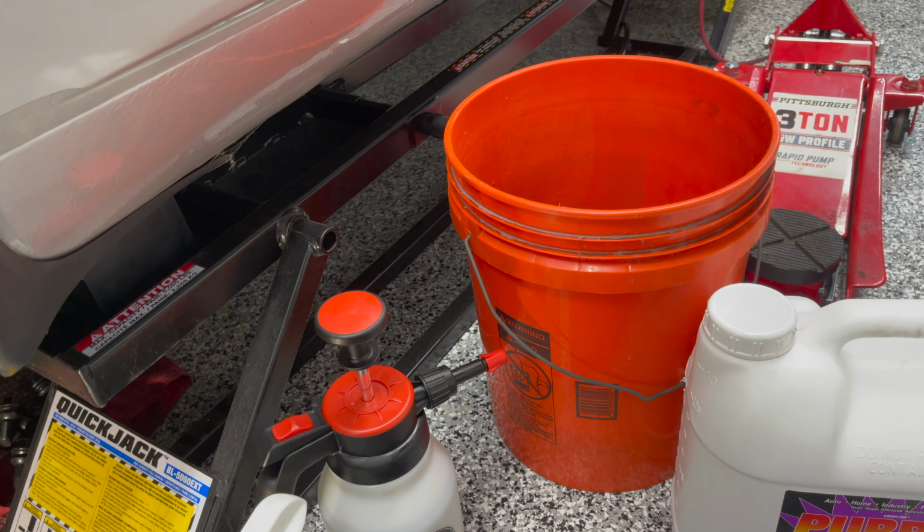All right, I'm ready to install the strut back into the car, but first, clearly, I gotta put it all back together. So these are the tools, and these are the parts that you're gonna need. So you have the parts that you've taken off of your Porsche. You've got the bellows, you've got the two, I'm gonna call them beveled washers, as well as the small washer that also is required, and you saw me grinding away the old rust, as well as the strut cap, and you've inspected it to make sure yours is in good shape. There's no cracked rubber, no tearing, no rust, all of that good to go. And then, of course, last but not least, is your spring, nice and clean.